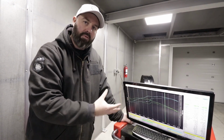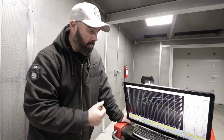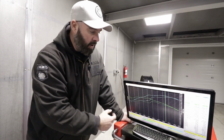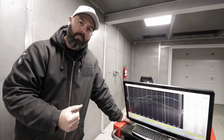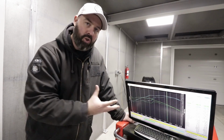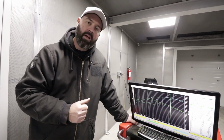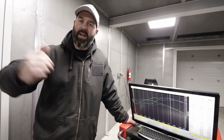We've really proven that the 3-inch exhaust is one of the supporting mods you need for the Gen Vs to really breathe. So in the sort of 5,500 to 6,500 RPM range, we've literally picked up 40 wheel horsepower. That's an absolute massive amount. As Sasha was saying, it's going to feel like a torque monster pulling out of the corners now. So I think that really shows you the potential of the Gen Vs if you have the rest of the setup well sorted out. So we're excited to get this thing out to the track finally in the spring.